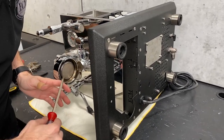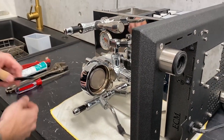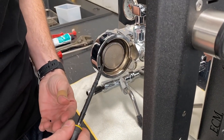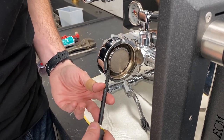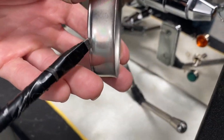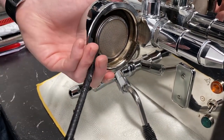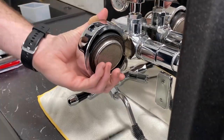Most people will say just grab here and yank out. Now, this is where my issue is with frequently doing the maintenance here. I like to use either a towel or I've wrapped my screwdriver in electrical tape — that way I'm not gouging up the edge of the group head. The way to get these out is to take the slotted driver and meet it up with the ridge. You just get your slotted driver right in there and pivot right off the edge. Sometimes you'll need to go a couple spots, but it'll usually pop right out.